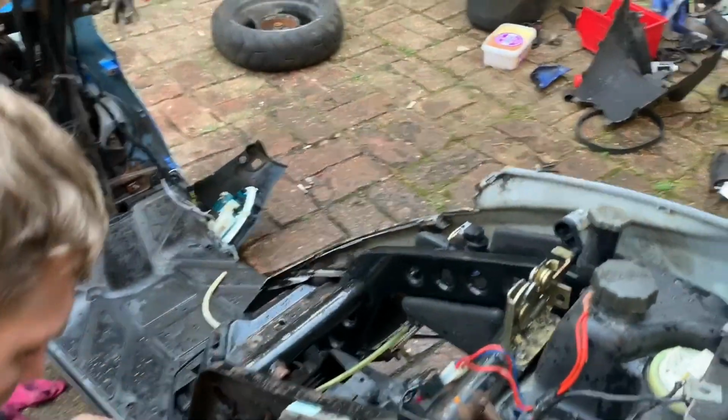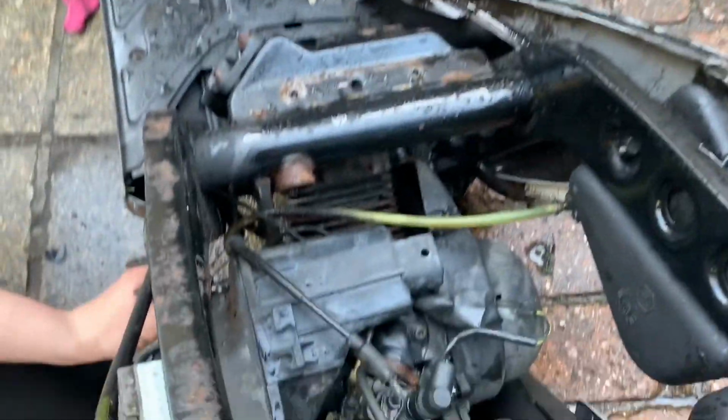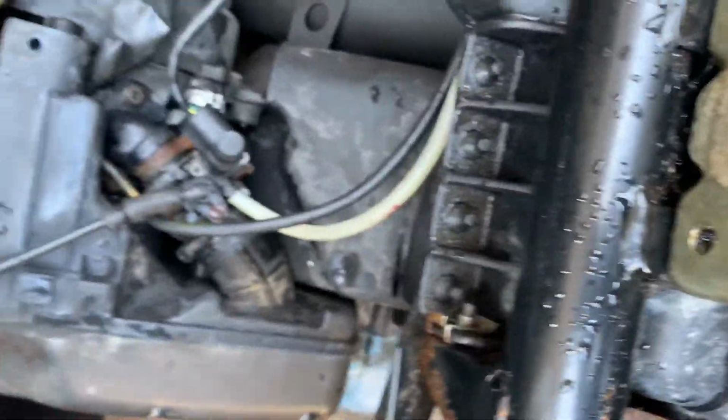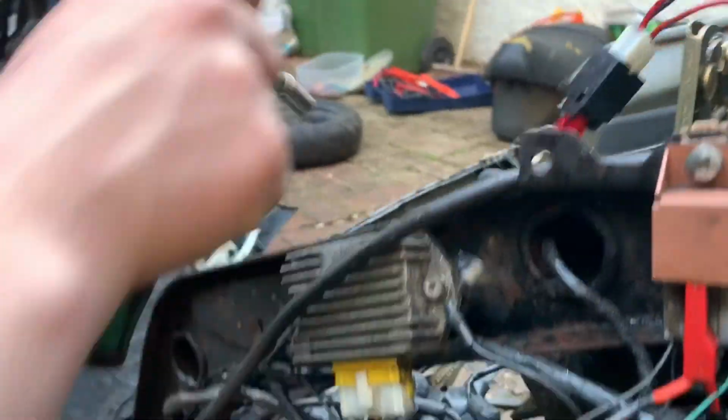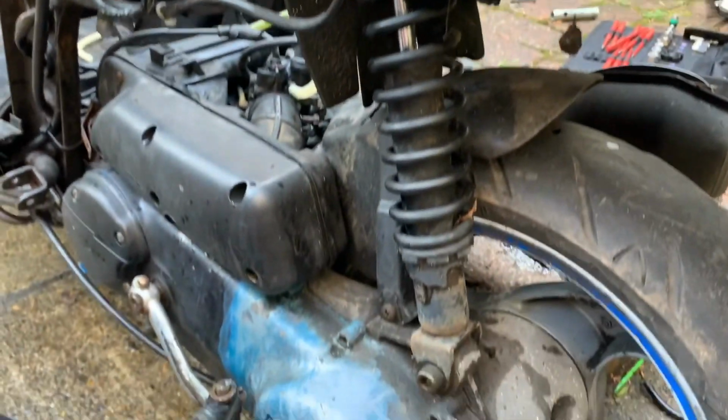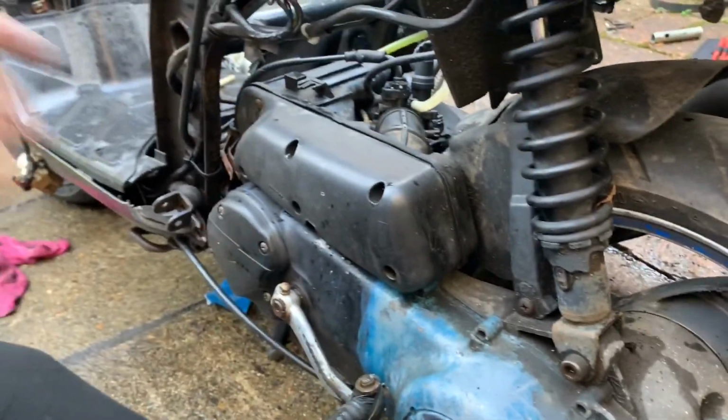I'm back. What I've done so far is I've put new fuel line on it, put the old vacuum line back on because there's nothing wrong with it. It's just a bit solid. Doesn't matter, it still makes a tight seal. I sucked the vacuum line, got all the fuel to bleed through into the carb. Done that. Tightened up the clamp on the carb. Topped up the oil. Topped up the petrol. Already had loads of performance oil in it, which was lit. And we checked the spark. Got amazing spark,